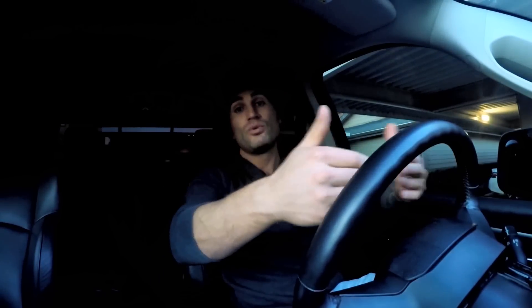I'm in a hot climate down south where we see temperatures over 100 degrees. When I had my AC running full tilt on a 100-plus degree day in stop-and-go traffic with the stock mechanical and electric fans, the AC was kind of cold but nothing to brag about. But after I deleted the mechanical fan and installed the v6 fan, on the hottest, most scorching days in bumper-to-bumper traffic, my AC is ice cold — which tells me that fan is moving enough air to cool the condenser.